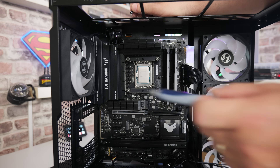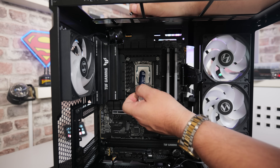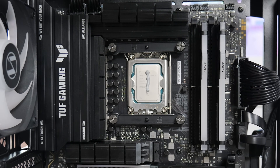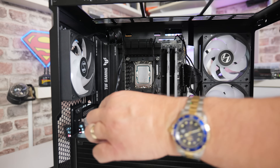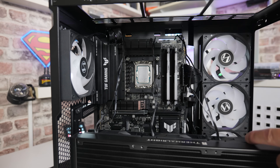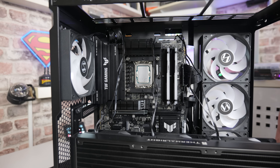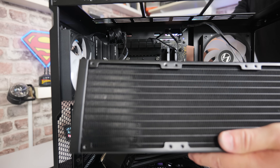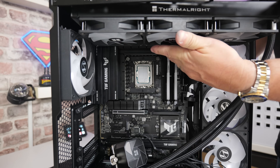Before we put the wires through, just to make it easier, apply some thermal paste onto your CPU. With the Intel system it's quite a big IHS so you can put a decent amount of thermal compound on there. If you want to, you can go ahead and spread the paste for even coverage — that is entirely up to you. What I've done here is passed through the cables from each one of the fans and routed the cables roughly in line with where they're going to go. You can then lift the radiator as one unit and gently feed the cables through as you go, then pull all your cables through so it's nice and neat.